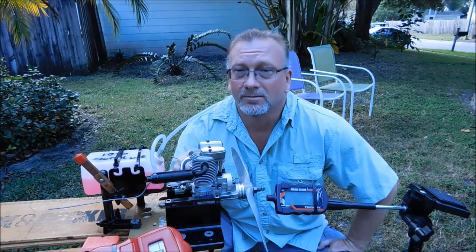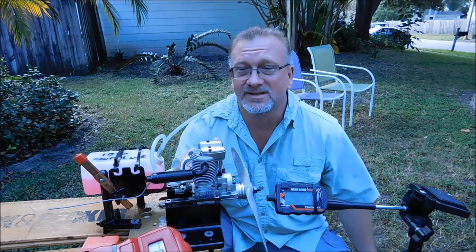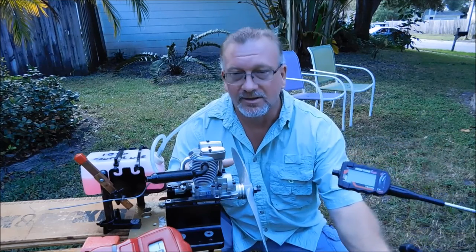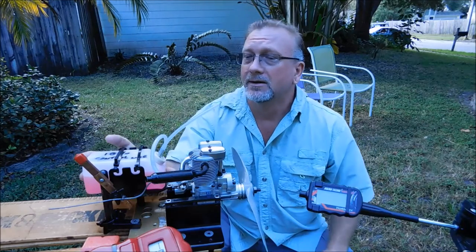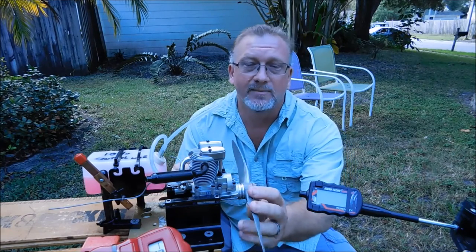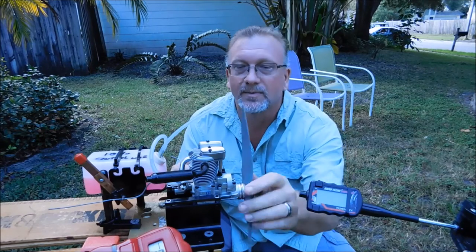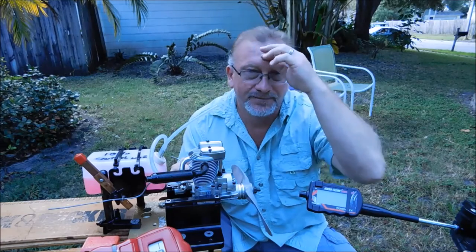So Marco, still a good purchase, great carb body, works well. As you can see, this engine was turning well over 9,000 RPM. This thing already turned off. It was turning about 9,300 RPM. So to the specifics, this is Morgan's 10% Omega with added caster, and I'm turning an APC 11.6 prop, the same size and pitch that I had on my open rocker engine.